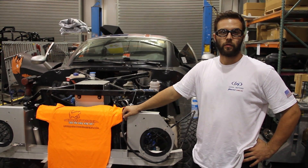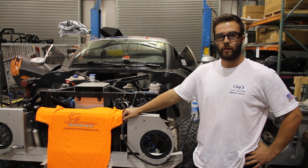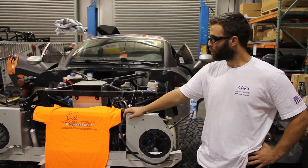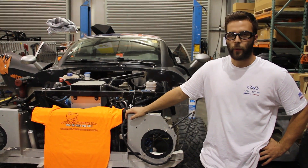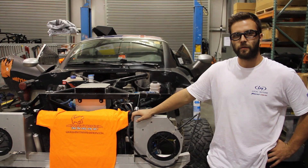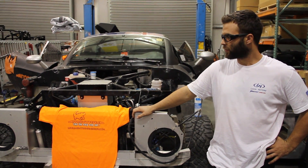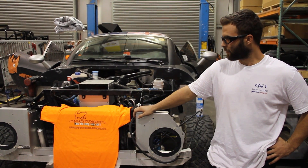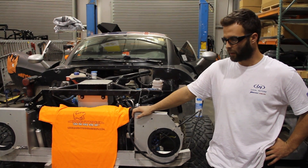Hi, my name is Ryan Hendrickson. I'm the service advisor over at Local Motors, and today we've got the Max Trax Rally Fighter in the shop. We're doing a prep that basically entails going over all the nuts and the bolts, the fluids, checking all the heim joints and the suspension components, checking the shocks and the springs and the valving. Pretty much pulled the whole front of the car off, pulled the bumper off.